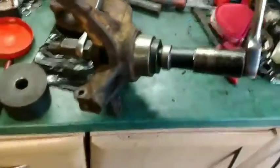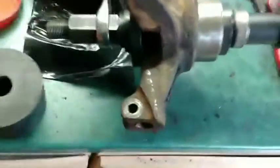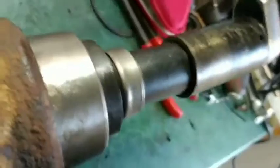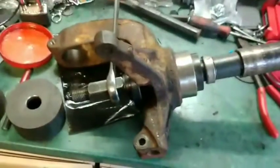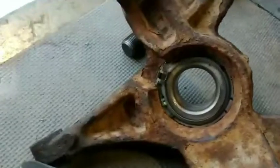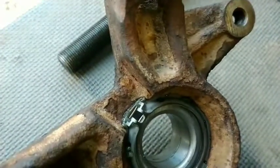I've lost my tripod — or it broke, actually. That's how you get to see the ratchet going. And the bearing is coming in. You get the idea — I'll just wind it the rest of the way. That's the first stage: the bearing goes into here, and you can see the rubber side with the magnets is on this side, right next to where the sensor's going to go. And that's why the cage has to go in first, because there's no way you're going to do it after. It only goes in this way.